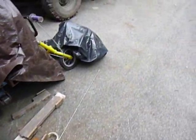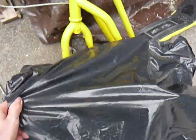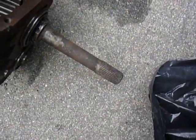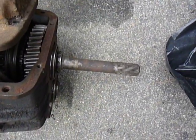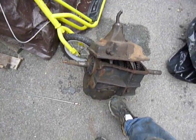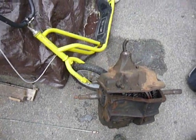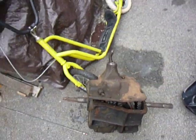I also got this transmission with the deal. This transmission is also a newer one, and it's got the coveted 32-spline output. This does not use that little coupler sleeve that the 10-splines use that totally gets screwed up. So 32-spline — the most heavy-duty you could get in an SM-465. This is the one to have. I think I'm going to hold on to it. I don't have a round-patterned NP-205 to bolt up to this, but I do have the adapter and everything.